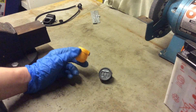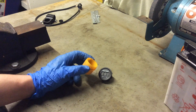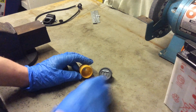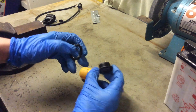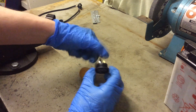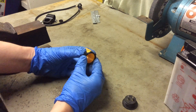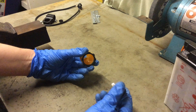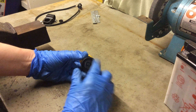I just need to put some cable ties down because that runs down by the clutch cable. We've got all the wires in place and the p-clip in place for the housing. I'm using half of a children's Kinder Surprise toy container — the part that comes out of the centre of the egg. I've already punched a hole out of the bottom and drilled it, and that will just bolt onto the p-clip. On the back of the voltmeter you've just got this flat nut — normally you'd bore a 30mm hole and slot this into your fairings, car, boat, whatever — and then this just screws onto the back. So I'm going to glue this to this, and once that's set fast I'll bolt it to the handlebars on the p-clip, pull the wiring through, connect it up, and then it should just screw straight on — job done.